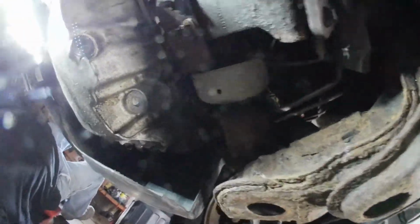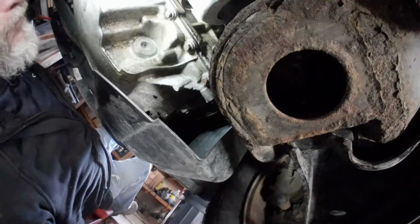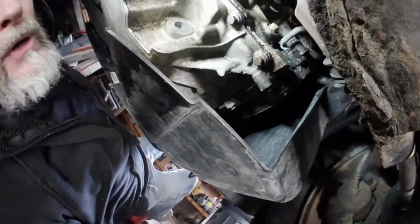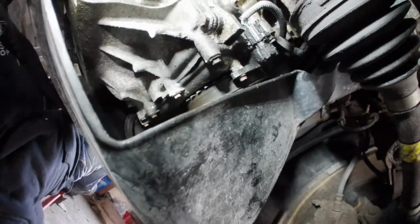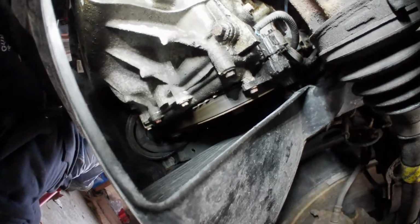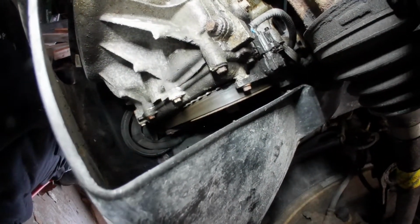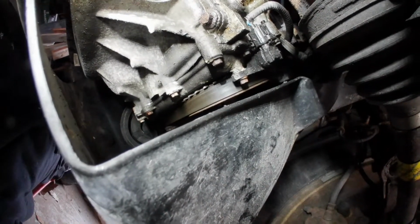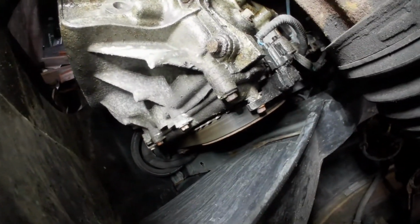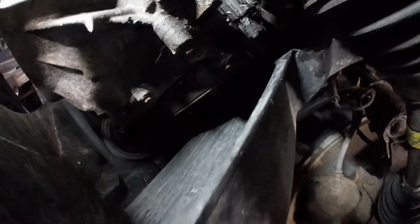I got looking at different things under here. And if you've been following me, you know I work on that Chevy Malibu all the time, and I've been concerned with the crank and the camshaft sensors. Well, look what I found on this. This is a 2.4 little four cylinder. There's your front crank sensor on this. Where on the Chevy Malibu's 3.0, it's the same place, but it's inside the harmonic balancer, which means you've got to pull that off. But this one here, it's external, on the outside, so there's no problem changing that one.